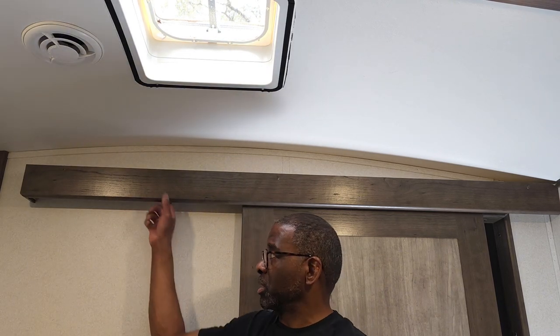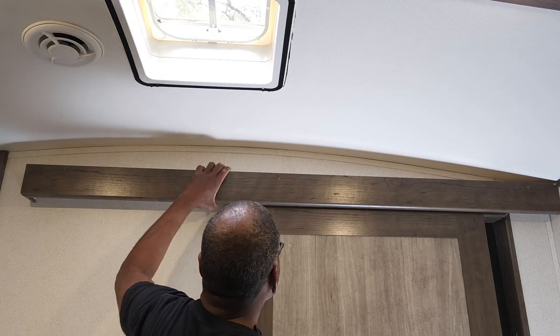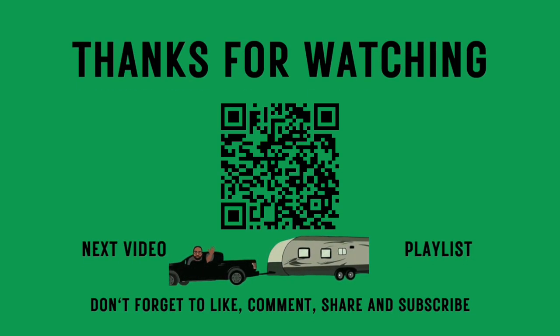It took me about 15 to 20 minutes — that's without shooting the video; with the video it took a little longer. Easy fix. I told you I took it to the dealer one time to have it done, but now I know what the issue was. I tightened the clamp and bent the latch down a little bit so it grabs more firmly and won't pop out. That's fixed the door. RVing with Tim out — if you like my content, be sure to subscribe so you get the latest videos as they drop. See you on the other side.